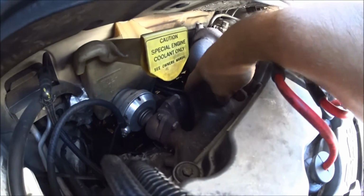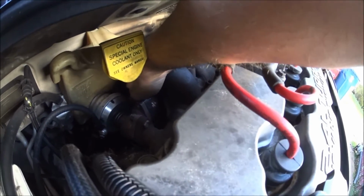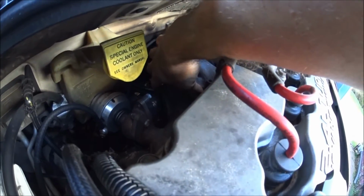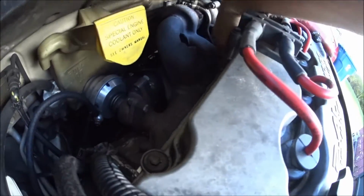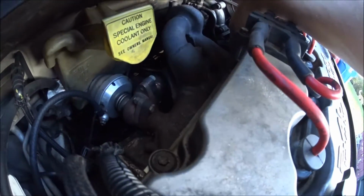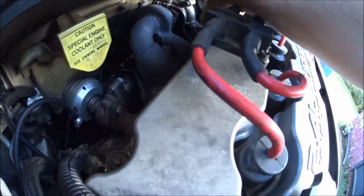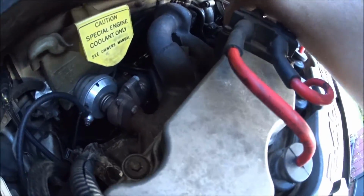There's probably bad light down in here, but it looks like this bolt here is loose. Yep, I could turn it with my finger. So we've got an exhaust leak right from the manifold to the elbow. And over here on this side, we actually have two studs snapped off. One feels like it's even with the manifold. The other one could have fell out or whatever. I'll have to get down in there and see.